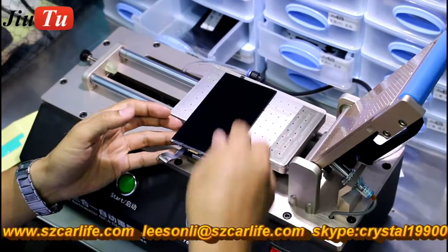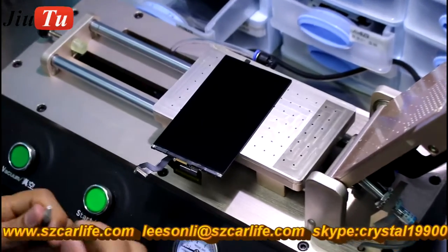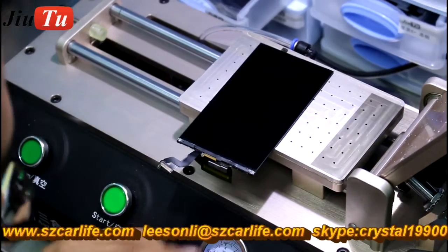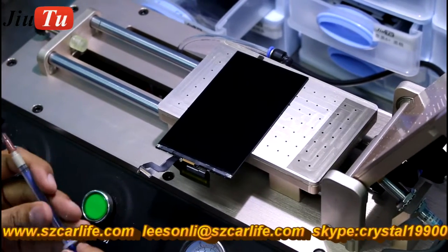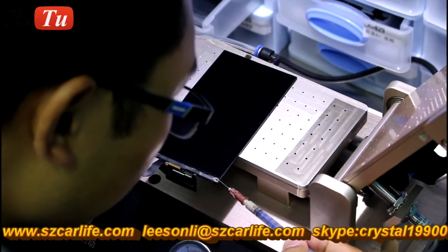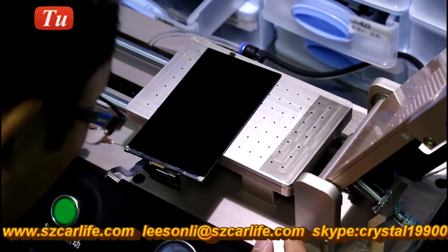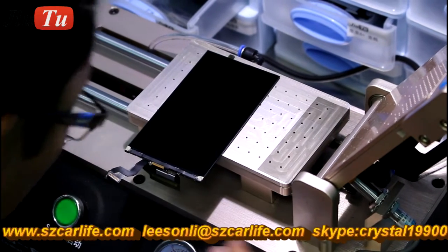The result like this is okay. We will use the anti-static glue to put on both corners and let it get connected with the polarizer film, so after refurbishing you will not have any static issue.